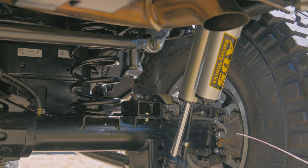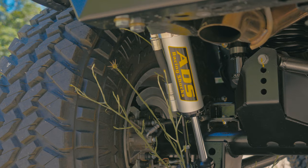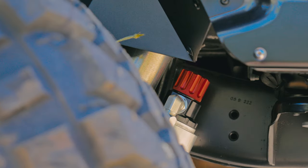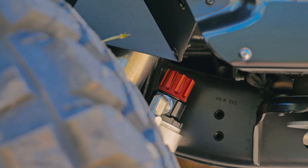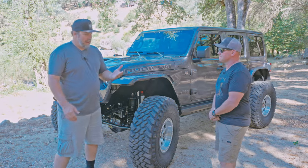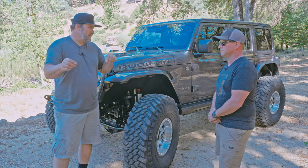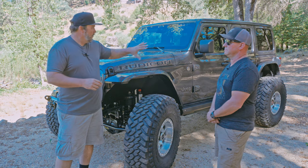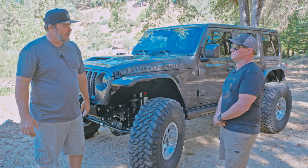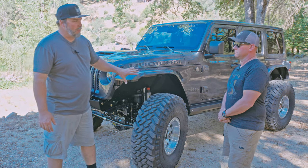Most customers that we have, we'll sell them a 2.5-inch clicker shock and tell them to adjust it to their liking. Not as many people mess with it, but you are that guy who's going to dial this in, right? Yeah, I hope so. When we brought it out of the shop, it was good, and I took it home and played with it a little bit, and now it feels real good. Our idea is to keep a little notebook in the glove box, so on a nuisance gravel road, you're at 2 clicks here and 5 clicks there, and with 500 pounds in the back, you click the rear to a certain spot. You're going to start collecting data, right? Right. I think we sent it home on the number one setting, right?